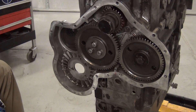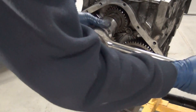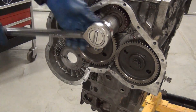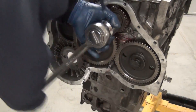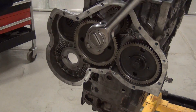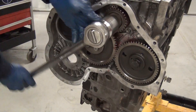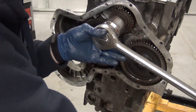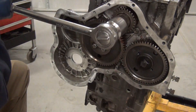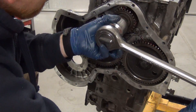We can rotate that around back and forth now — everything's in place, everything's good. I'm just going to run this around a few times. Oil pump gears are getting plenty of lube on them; they're looking good. The reason I want the marks back is to line up the injection pump. Better to do this before putting the cover back on, so just leave it.